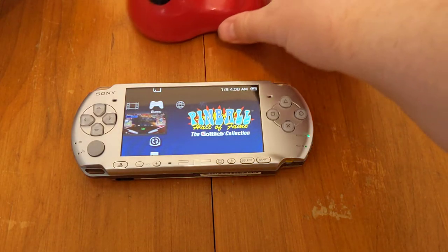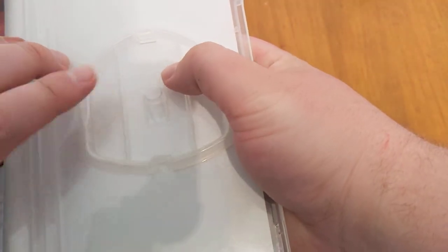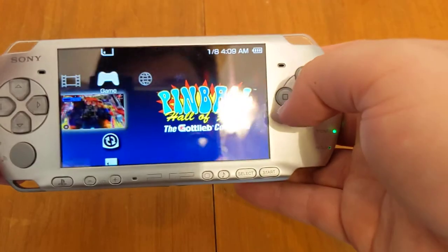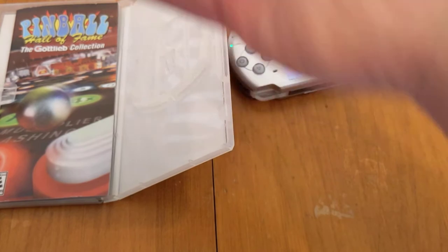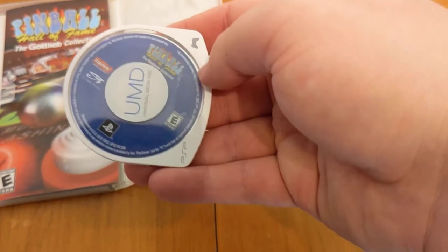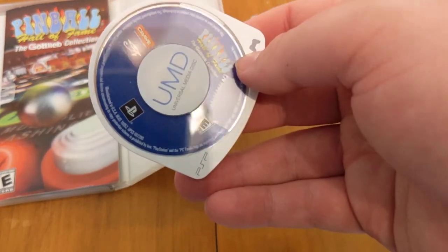This is easily the cheapest solution I've found for this - it's just scotch tape, no tricks or anything like that. A lot of disc-only games you will find, somebody has kind of pushed down on that part of the UMD. You might do it sometimes when you're trying to get it out of the case - they're kind of awkward to deal with. So I know that this happens a lot where they get broken like that. That's the easy way to fix PSP games with this issue. I actually did just get this game today - brand new for my collection - and it would not play when I started it up. That copy of Ghost in the Shell is not the only one I've had to do this to; there's been like four or five or six others. I hope this helps people out that are just looking to get some kind of a PSP collection going, because a lot of the discs, even if they don't play, actually do as long as you know how to fix them.